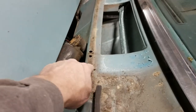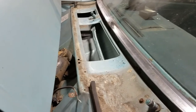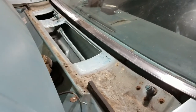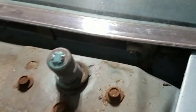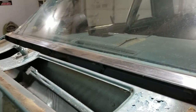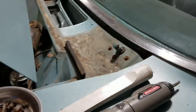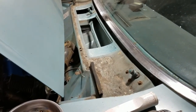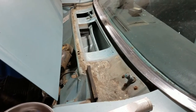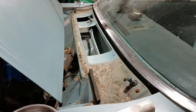I'm going to use the external magnetic version for now and hopefully that'll be adequate. If I have to come back and put something underneath, it's only about eight screws and two wiper blades to get off, so it's not a big deal. Also, this gasket that runs along here is completely rock-hard and falling apart, so I'll have to order a new one. When you're doing this, I encourage everybody to vacuum all that gack out and also get underneath the windshield molding — there's an accumulation of crud there that's just going to hold moisture. If you're going to replace the cowl panel, you're going to pull the windshield out too. Cowls are bad news on these Fords — it's just one of those things we all have to deal with.